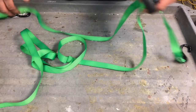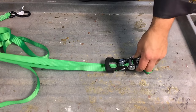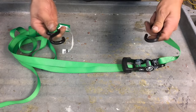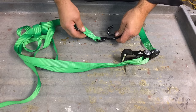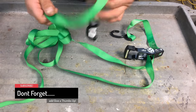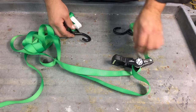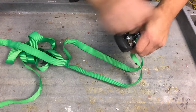If you have a situation where you don't have a long enough strap to tie your load down but you have multiple ratchet straps — on each end there's a hook. Some ratchet straps do not have hooks; you can buy them without hooks. I prefer to buy them with hooks for the simple fact of tying a knot. If you tie this in a knot to tie your load, you're going to cinch that knot so tight you're never going to get it loose — you're going to have to cut it. There may be a situation where you don't need hooks, where you would wrap it through and then wrap it through itself in a circle.